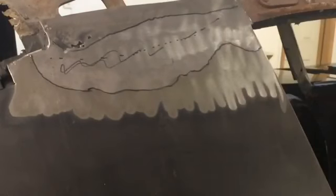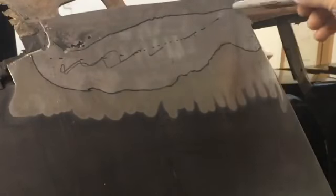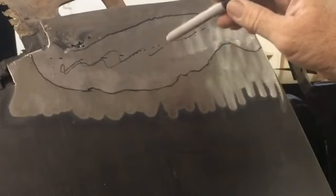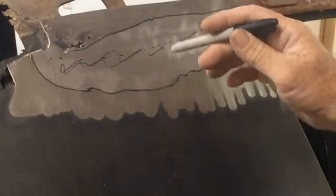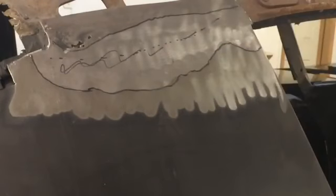You can tell a big difference in the sound of that lead versus metal. I don't want to strip it back and grind it out. I think the best way is to melt it out so it doesn't get airborne. Lead is pretty bad stuff and you don't want to be breathing it in, even with a respirator.